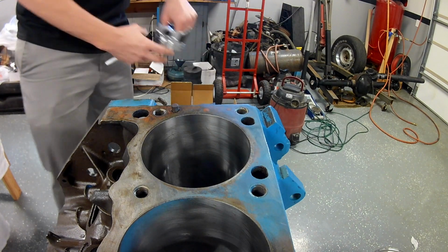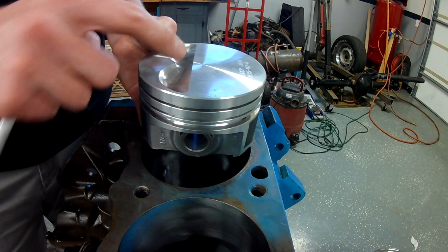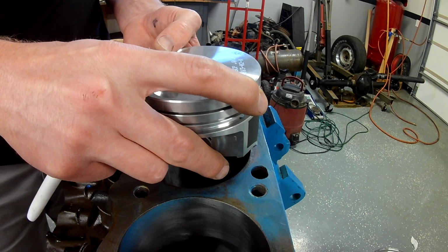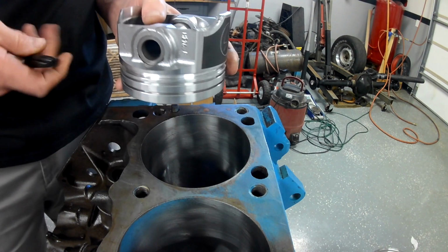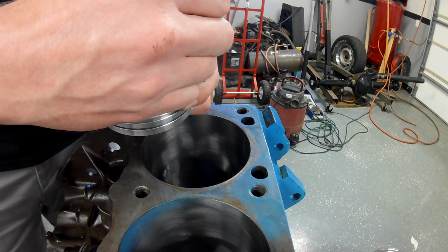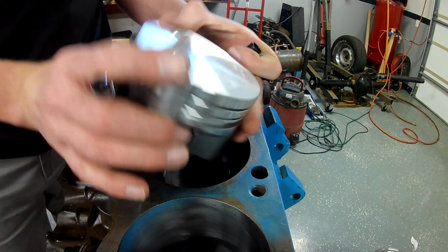Alright, number 2 piston. Those will be going on the upside. A lot of times they do it where you can read the number if it's in the motor. So that's not always true, but most of the time. See, that mark's on that side this time, so if we ignore it, we put our arrow on this side. That's number 2.